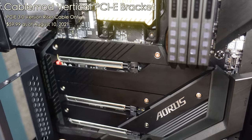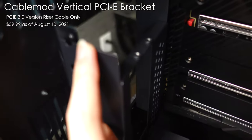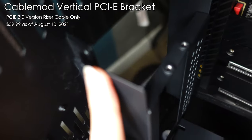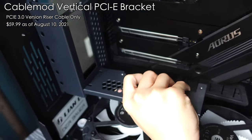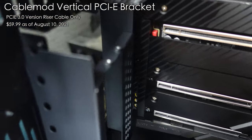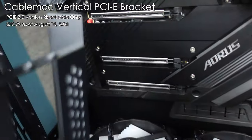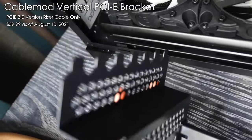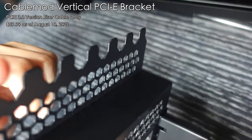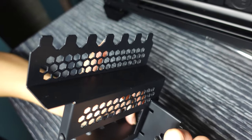This mount here is the CableMod mount. It looked promising, but it doesn't fit flush with the case — see that gap right here? The reason it doesn't fit flush is because the tabs at the end that go into the slots of the case are too long. What happens is it hits my power supply unit and won't go any further. I suppose you could put a screw in with a washer in between, but I decided to just move on from it. No bueno.